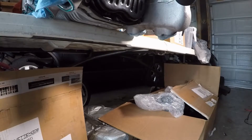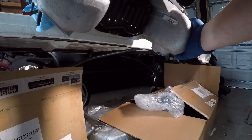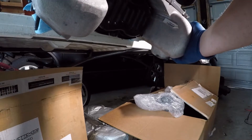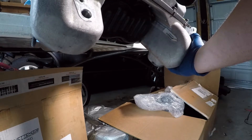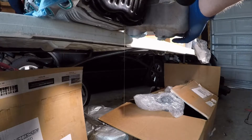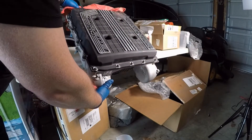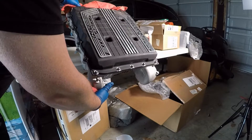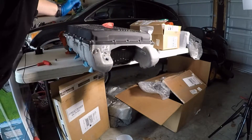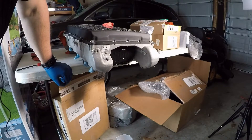It's definitely slowed down to a drip. Let me see if I can prop this up a little bit to get any more out. You might need to do that — tip this thing back a little bit to let the oil drain back into that back part of the supercharger where the pan and the drain plug is. I'll wait a minute and then bring it back up flat to capture any more oil that could be in there. I think we got the most of it out.